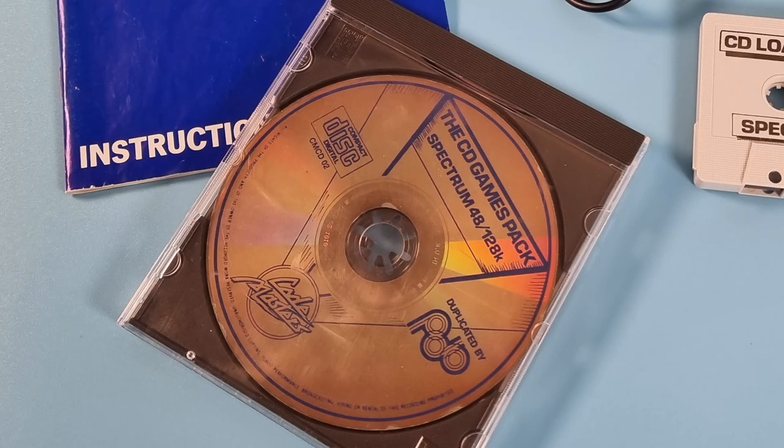What's on the CD, and how is it faster than tape? The CD is an audio CD and not a data CD. CDs have a cleaner signal, less prone to drift, wow and flutter, and all those other things you get with tape. This means that the baud rate for the data can be increased, along with some trickery, allowing for much faster loading. They use the Kempston joystick as well to help with the loading speeds, and the fact that you don't have to reset your Spectrum when you want to change games makes things a lot quicker anyway.